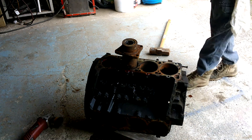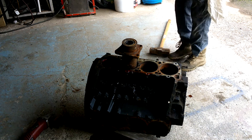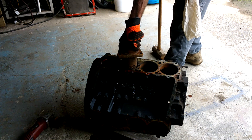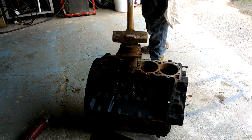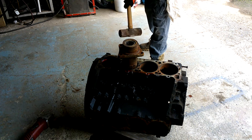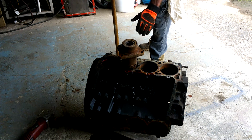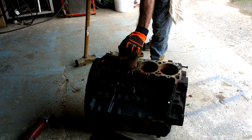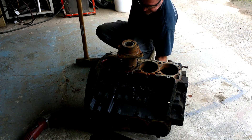Here it goes. I've got an old axle tube out of a truck in here. I've got it centered on the piston and I've made a mark on here so I can see if it moves or not. I'm going to use the side of the hammer because it's a tube. It looks like she's moving. I want to make sure I'm not at the bottom of the cylinder — I don't want to break anything out of here.